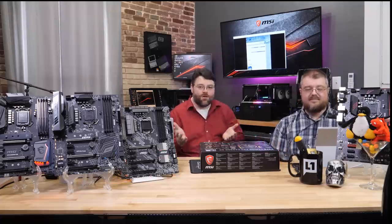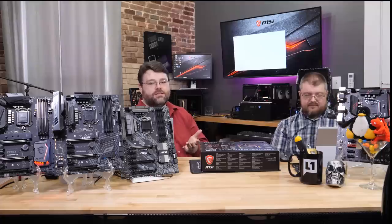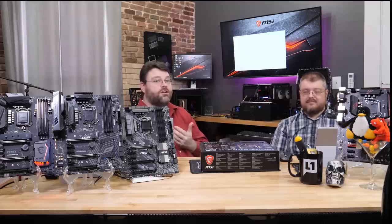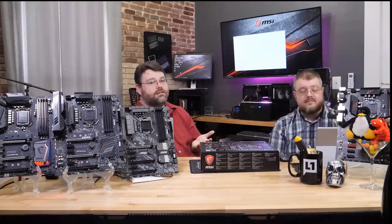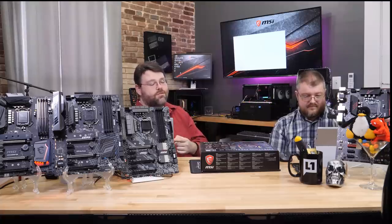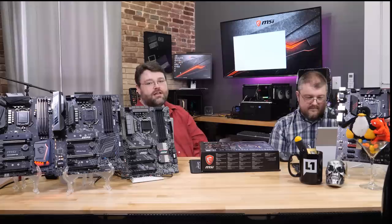You already know how the CPU is going to perform, because there existed six core CPUs with a similar cache architecture, but on a different socket. It was previously like the six core X99 CPUs, but nowhere near these clocks. So ramp up the clocks, mess with the cache a little bit, add some more advanced features like AVX, and bam, you got that on a new socket. You don't need quad channel anymore, because the DDR4 memory clock speed is finally getting up there to the point that two sticks of memory can feed the CPU like four sticks used to be able to.